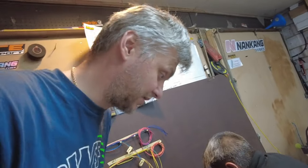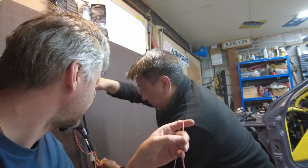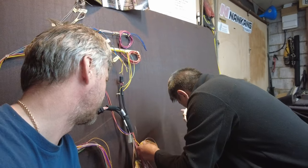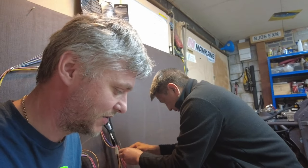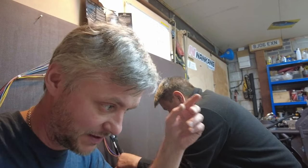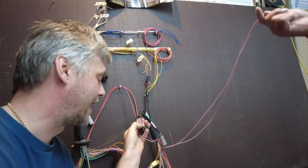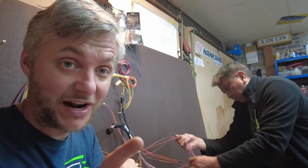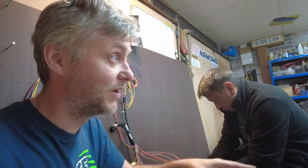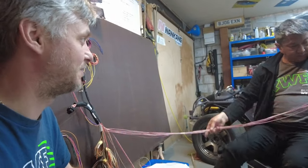A peculiar thing we just found gave us a little bit of confusion — we had extra wires. Haltech thought of everything. There's an output called HCO — High Current Output — and it had three extra wires all the same color. We traced them and they all came out of pin number three, which is C01. Haltech is basically giving you three lengths of wire going to the same output for your headlights, so you can run from the same loom without splicing anything — one goes to the back and two go to the front. Very simple.